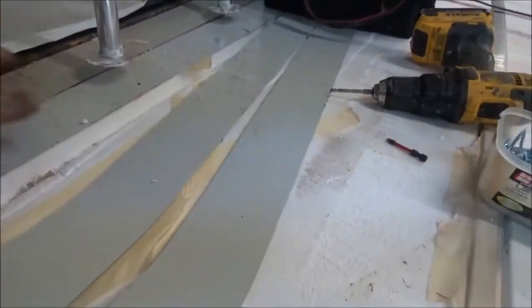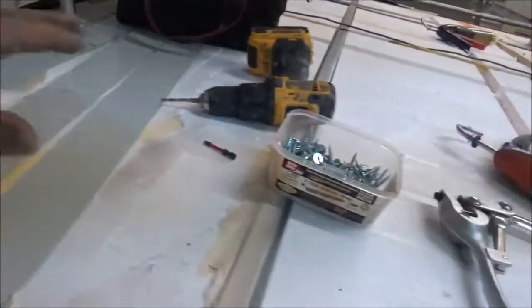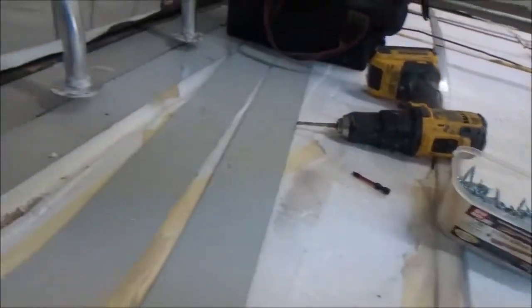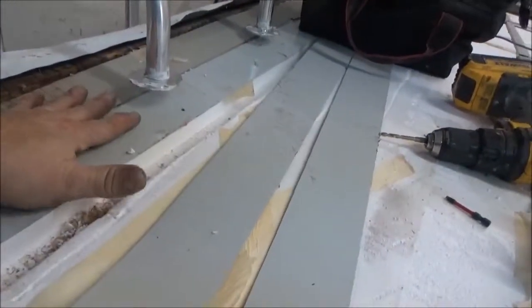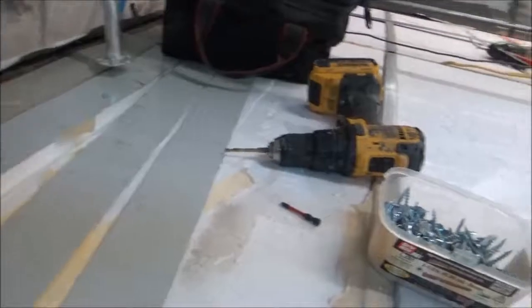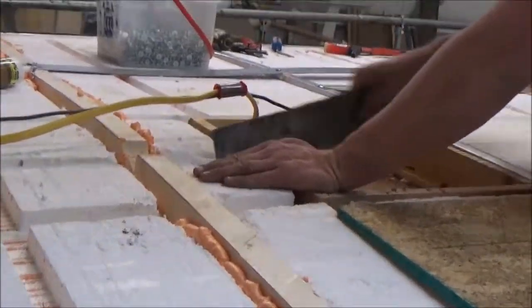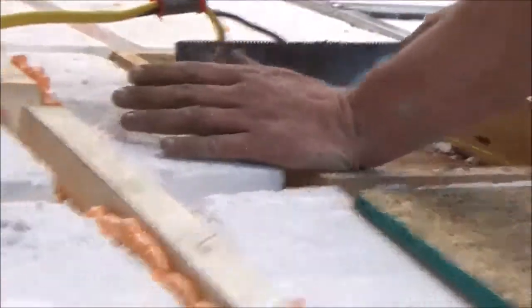That's crazy. We've got a new roof deck going on here anyways. It'll be a little bit thicker because of the span and everything and how much trouble this has had. So we'll put that down and it'll have a lot more strength. It'll be a 7/16 board is what we're going to use. So then all we're doing is making sure this fits right now, where that collar right there fits in that slot. It looked like it was raised up. That's why we want to get that adjusted. So that's what we're working on right now on this old Condor.